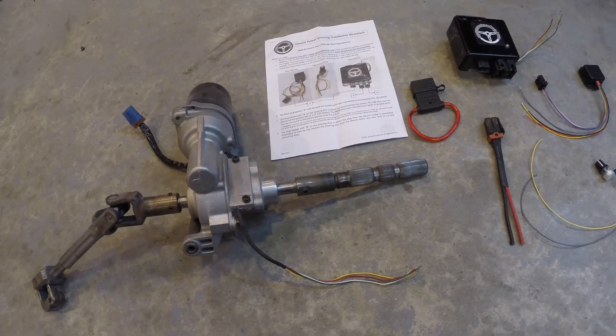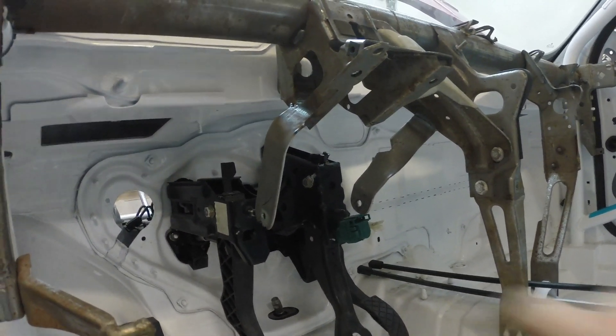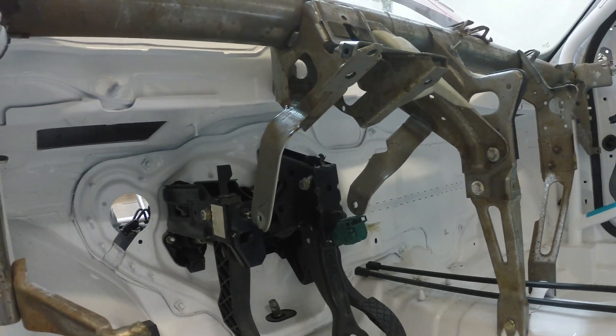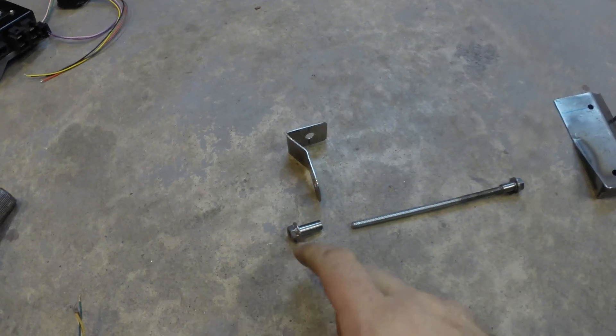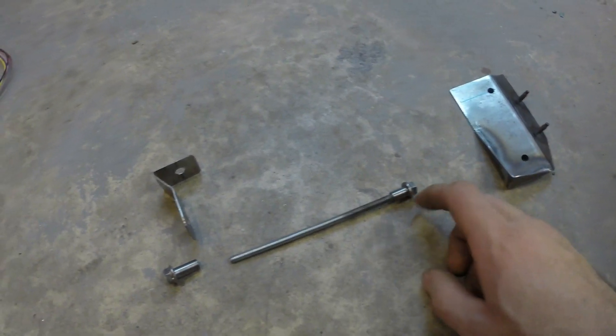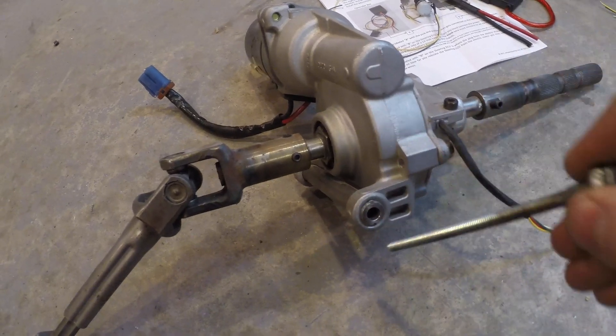I'll put a link in the description to my Instagram that shows in detail with pictures how all that was done. Now for mounting, you can see I cut a lot off of the dash reinforcement. I made these brackets here, welded them in place when I had the control unit taped in position to the main bar to get everything lined up, then welded those brackets to the dash bar with everything held in place. I also had to lathe this little spacer nut, welded a nut on it, then laid this spacer too and welded a nut on the end to make a long custom bolt and custom nut, because the all-thread quarter-inch was too small and the next size was too big. So I made these spacers to make up the difference. Now we can get all these components mounted in their place, and the next step will be moving on to getting it wired.